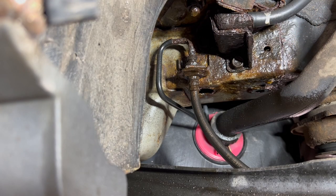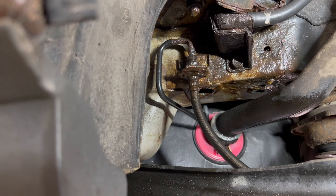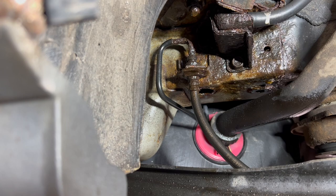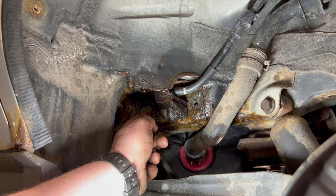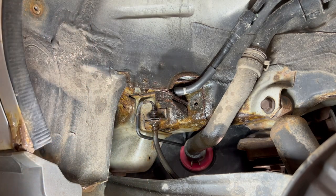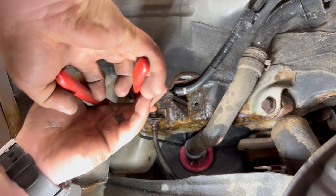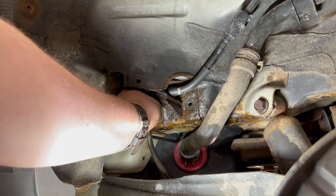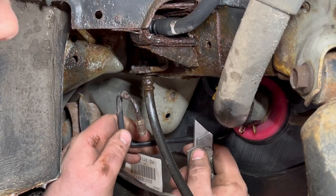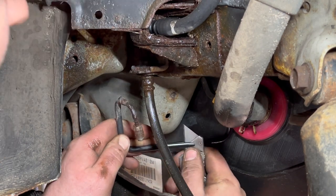There is our leaky little devil. So we're going to come down here underneath this, between the fuel tank and the frame there, and use a union and a couple of flare nuts and repair that. Ideally, we can get just enough heat up here to break this loose, but gripping it when it's 50% missing is kind of the struggle. So hence, some alligator pliers. We're going to come in here and strip off some of this garbage, hopefully without slicing ourselves open.